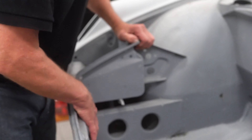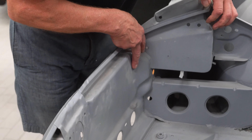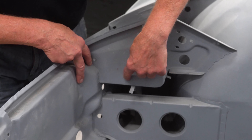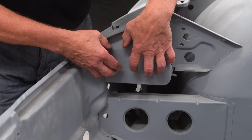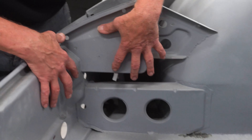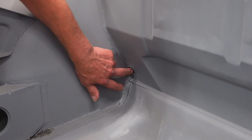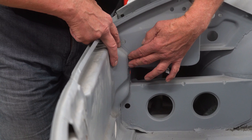First of all, we can start with the front panel. The front panel of this car can be identified by first the small bump on the side next to the headlight box. Notice the two holes here for the serial number. All 914s had a serial number plate right here from the 70-74 models, and the 75-76 as they moved it to the bulkhead.